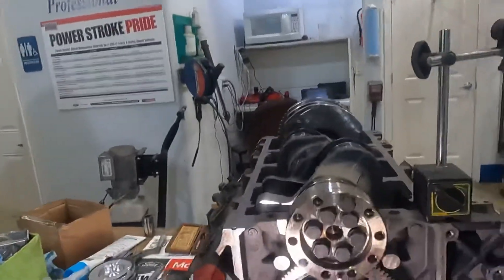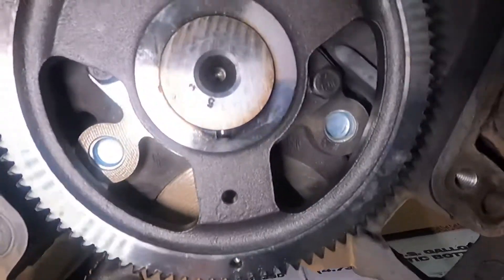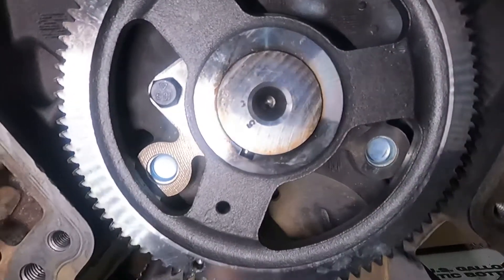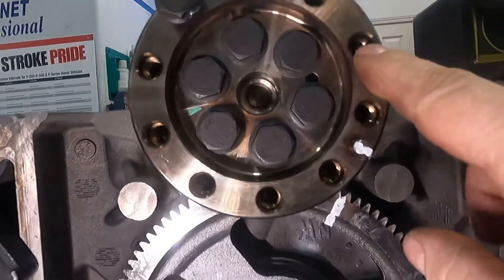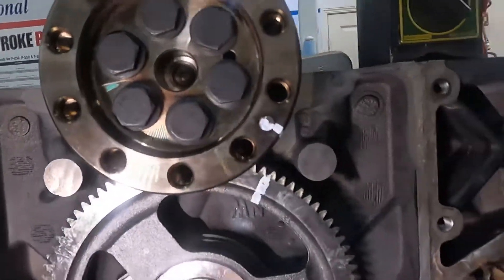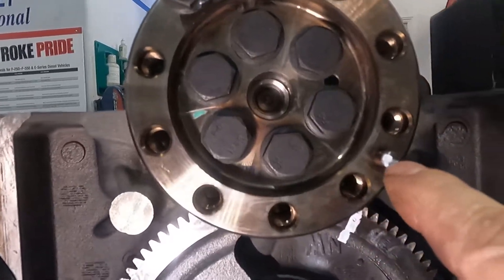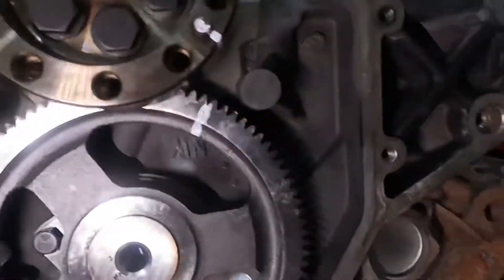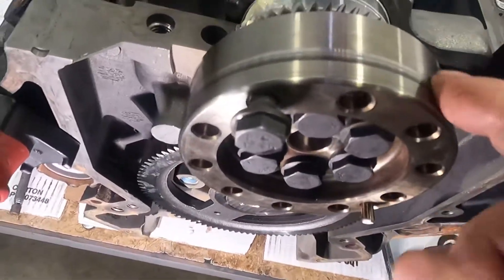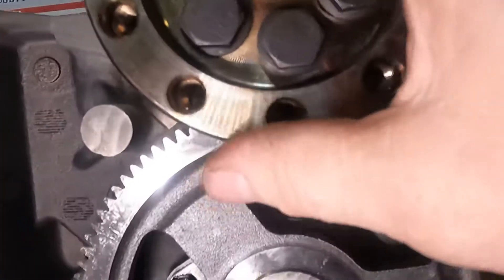First I installed the cam bearings and then the camshaft. I put a paint mark on the timing mark — the dot right there — and brought it down so I could see it. On this adapter, don't pull this off because it's centered and has the proper runout in it — there's no way you're going to get it back on there correctly. In between these two bolts, directly behind the dowel pin, is the other dot on the crank gear. The crank gear is pressed on and keyed to the crankshaft, and this adapter is torqued with the runout set. Don't mess with it — no reason to.